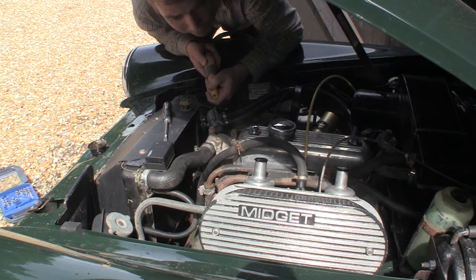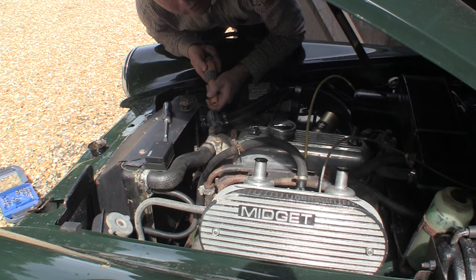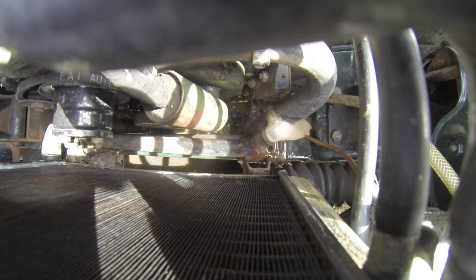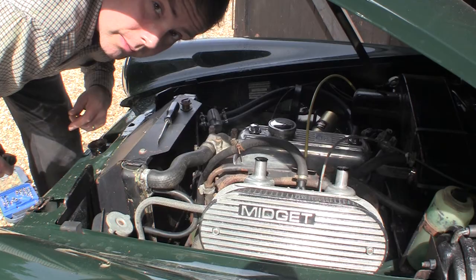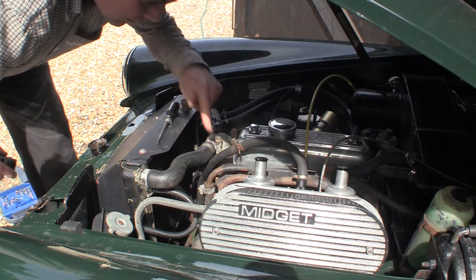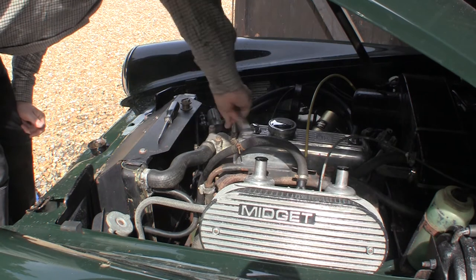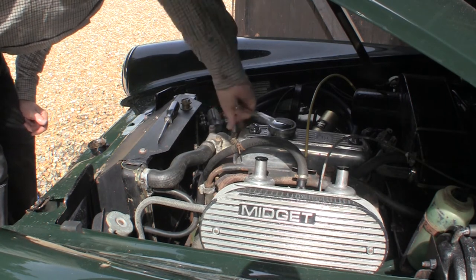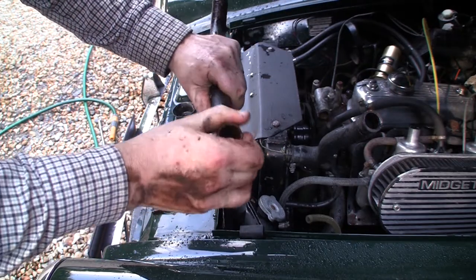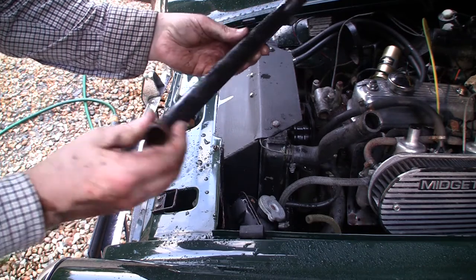That is the chemical flush draining. Let's flush it through. Essentially I've only flushed one side, so I need to back-flush through here. The thermostat housing has got to come off anyway for the new thermostat. This is the bottom cross connection tube for the radiator — I had to take that off to get the hoses off the bottom of the radiator to give it a good flush. But this pipe's not the greatest; I'll clean up a bit of paint.